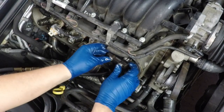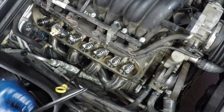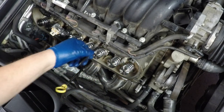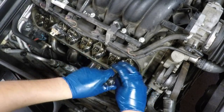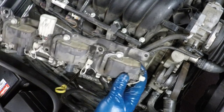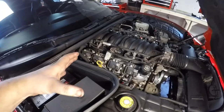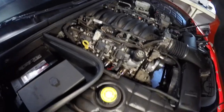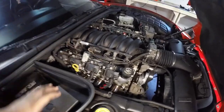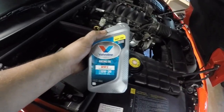We'll repeat that process three more times. With all the springs done, we're ready to get the rockers in — starting with brand new push rods from Texas Speed, then getting the rockers tightened and torqued down. We'll stick the valve cover back on and then get the coil rail on. Got the coil packs installed on both sides, plugged in, and we're just about ready to do the first start. Hood's already on — we just have to add coolant, oil, and power steering fluid, then check over everything one more time.